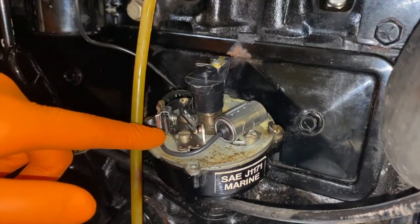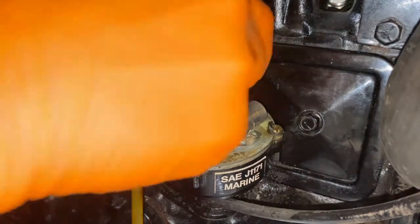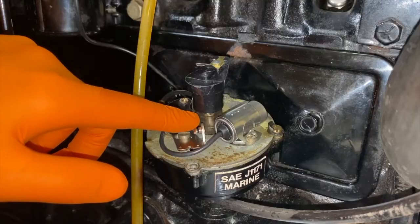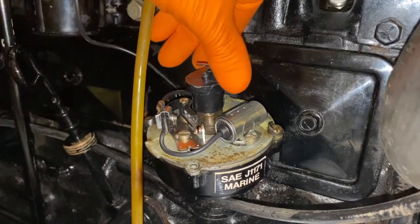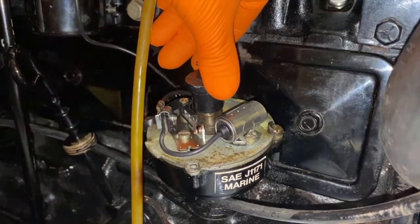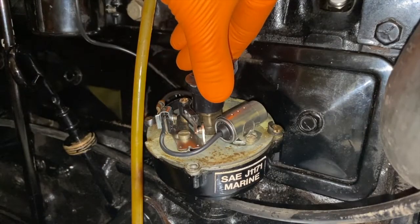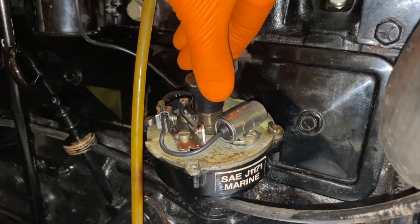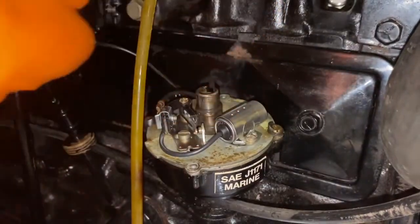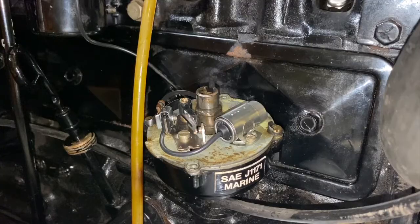Here's your condenser — it feeds into this electrical connection fitting and is secured in place with a screw. Then you've got your top rotor, which I can pull off to show you the high points and low points of the actual shaft. For this project, you want to make sure it is on a high point. If I turn the shaft, you can see the actual point move in and out. Right now I am on a high point, and as I shift it clockwise, I move to a low point, which pulls the point inward and makes contact. Inside, you've got the shaft that feeds all the way down inside the engine where the spline gear feeds into your cam and crank system.